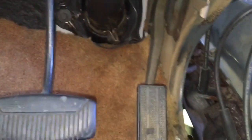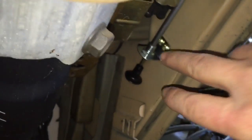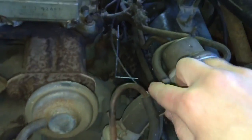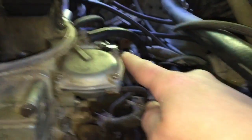On the left side of the doghouse there's the accelerator and brake, and just on the side there is where I decided to mount it. I had to drill some holes in there and I think that'll be just fine. I also came up through here for the cable, went behind the bracket, and then drilled a 3/16ths inch hole for the cable to come through. Then we're going to go right into this area here with this L-bracket, which will be essentially a straight shot right to where I need it on the lever.